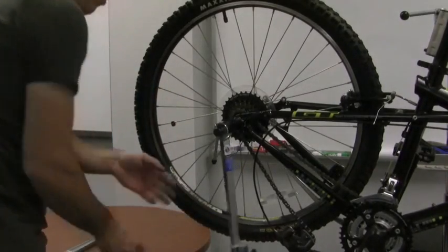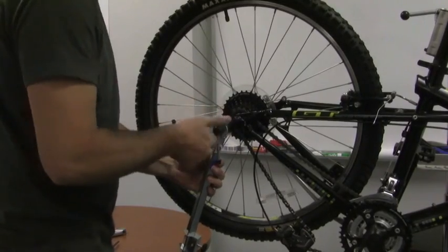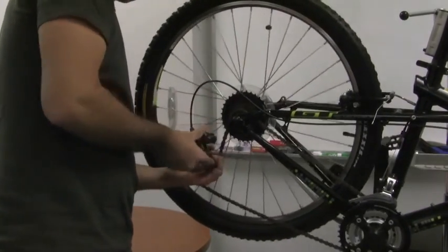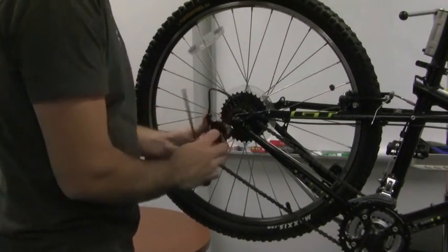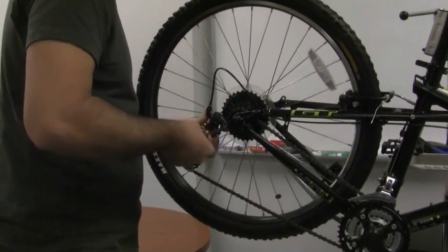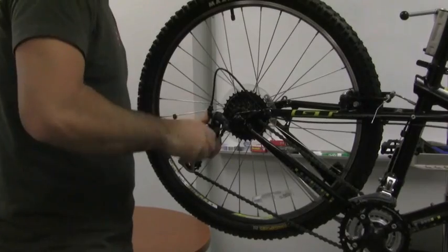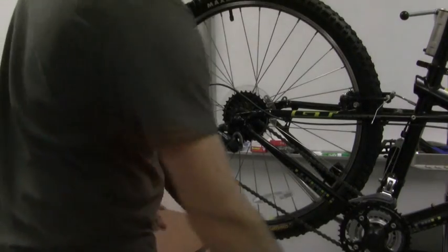When you're done, go ahead and remove the tool and reattach your derailleur. When you reattach the derailleur, you'll have to go against the spring and get it high enough that the small screw here — called the B screw — is clearing the little tab on the derailleur hanger. Go ahead and put that on, be careful with the threads again as it's pretty soft aluminum. Once you're done, get that nice and tight and check your shifting again.